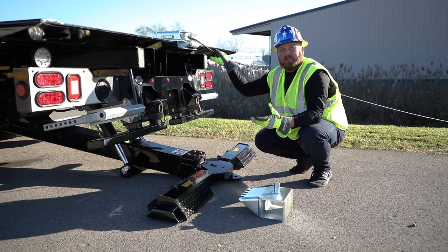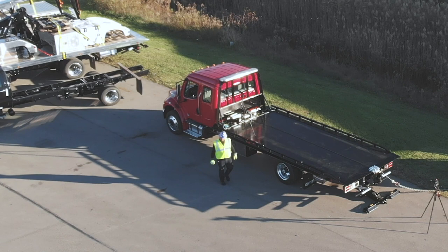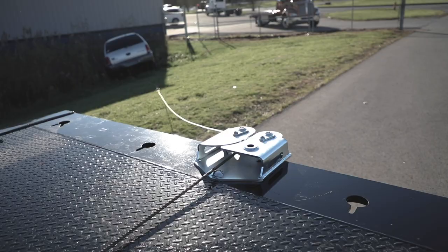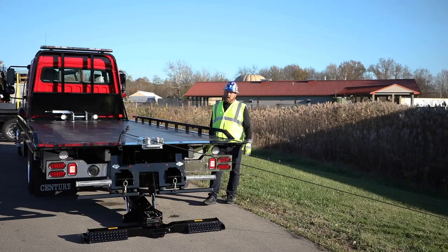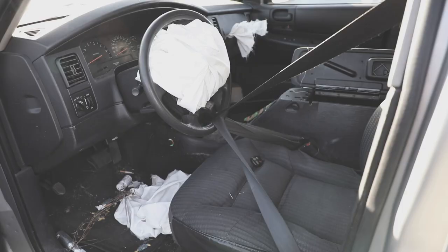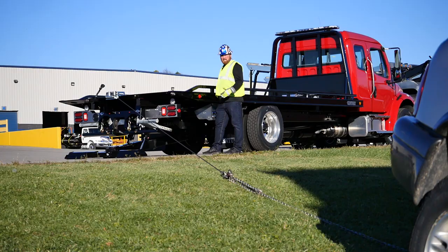Remember, on the side of a road you never want to be on the driver's side due to traffic, and if something breaks you'd be right in the line of the wire rope. So today I'm going on the passenger side for my own safety. Let's put this new attachment to the test — I've got a Durango over here in the ditch. I straightened the steering wheel and tied it with the seat belt so the front tires don't get cattywampus coming out. Let's give it a tug.